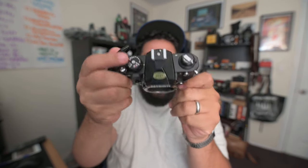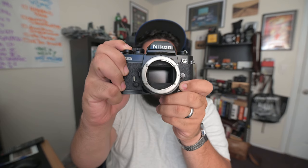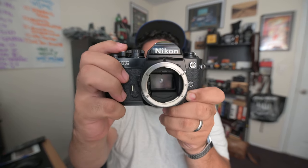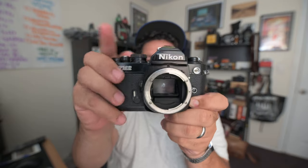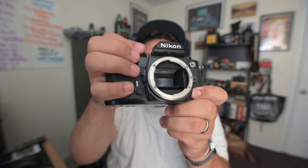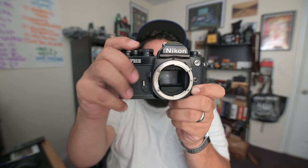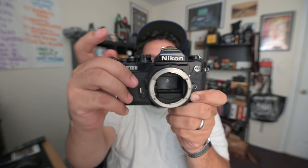While you have the lens off the camera, it's also a good time to check the condition of the mirror inside the camera. Leave the camera in bulb mode and check that there's proper travel with the mirror, no damage, and nothing restricting it - just nice fluid travel. Once you see it's good on bulb, pop it over to the faster speeds and make sure it operates flawlessly. That's a really good way to check the mirror of your SLR.